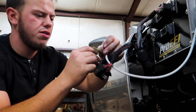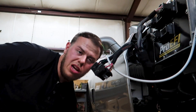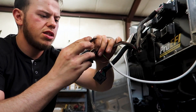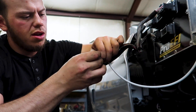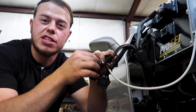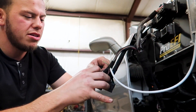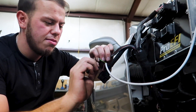We only have two more wires to go to the other plug. J1B09 - splice the black wire in. This is J1B, now we're looking for number nine - it's going to be the center one. That one's exposed. I'm going to take the black wire and wrap it up, then we can just solder that connection on. I'd love to use heat shrink, but since I'm not actually cutting the wire in half I can't use heat shrink even though I've got it right here beside me. I'd rather just not cut the wire in half especially so close to the plug. Super quick and easy, still looks good in my opinion.